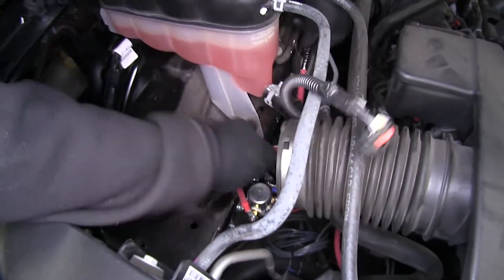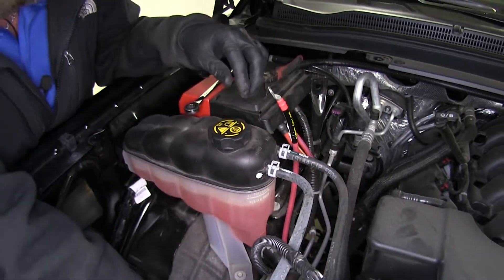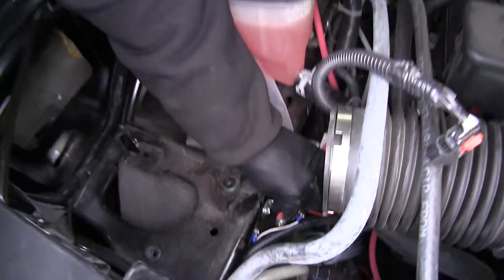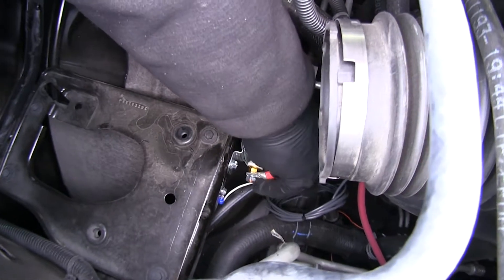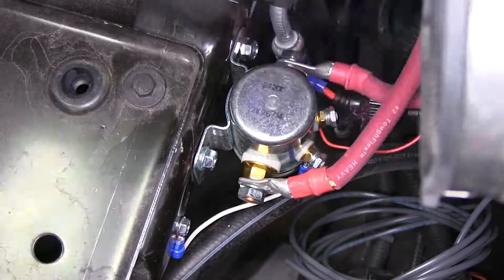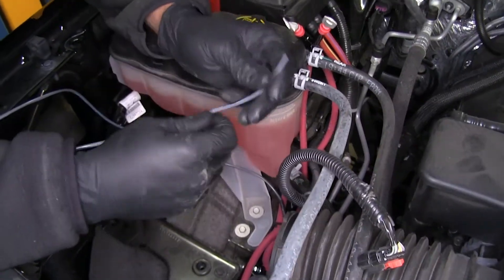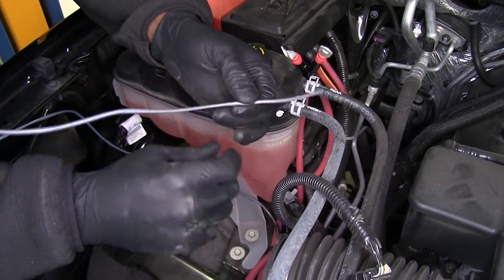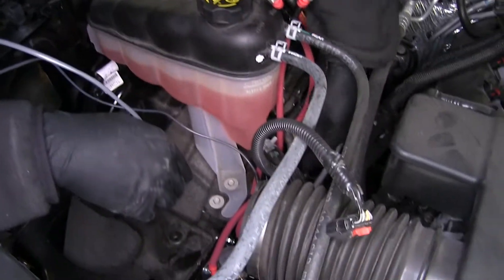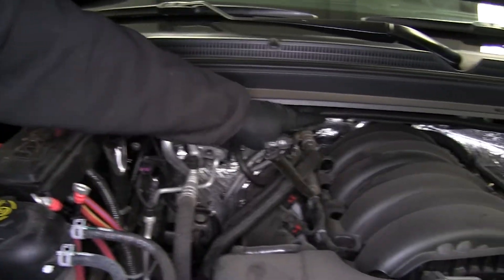Now we want to adjust and route our cables over here towards our battery. You'll see we've got one that says 'battery cable' and one that says 'battery post.' You can rotate that on the post — you just need a half inch wrench to loosen up that nut, which allows you to adjust it according to your application. I'm going to run the gray 2-wire right down along our wire looms and then right across behind that wire loom, using several zip ties to keep it up and out of the way.